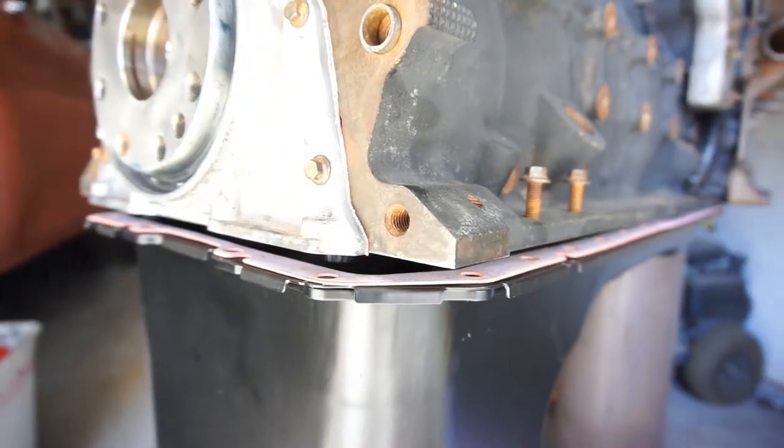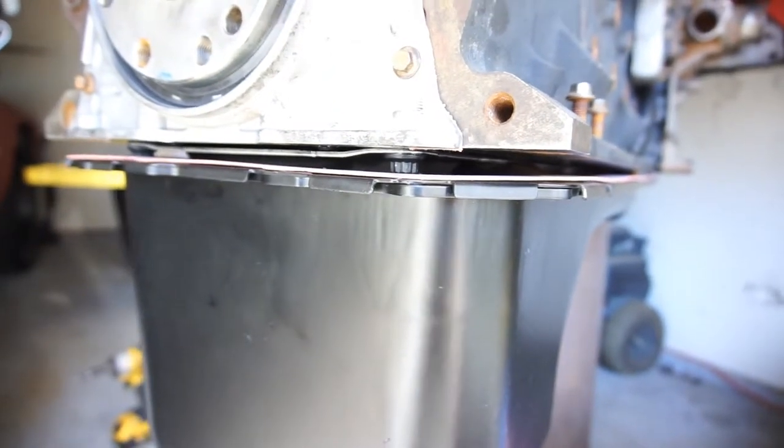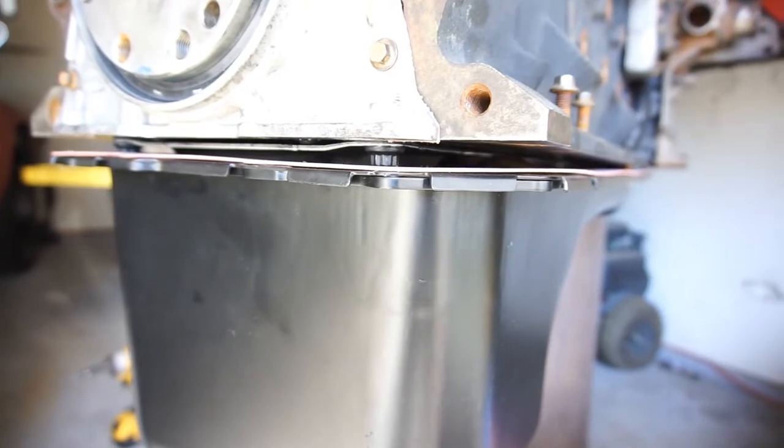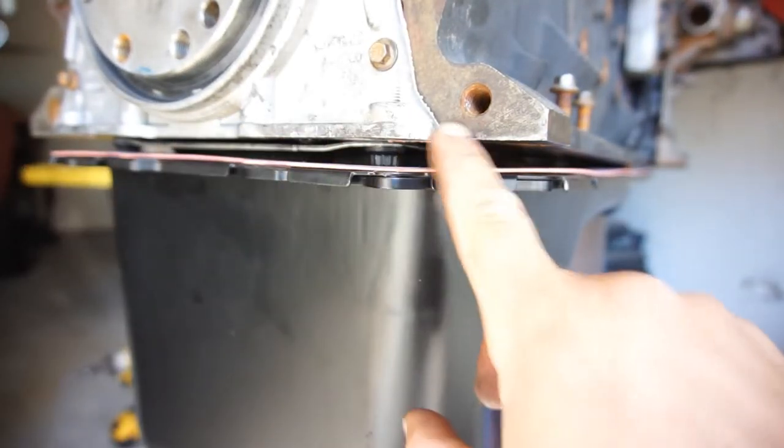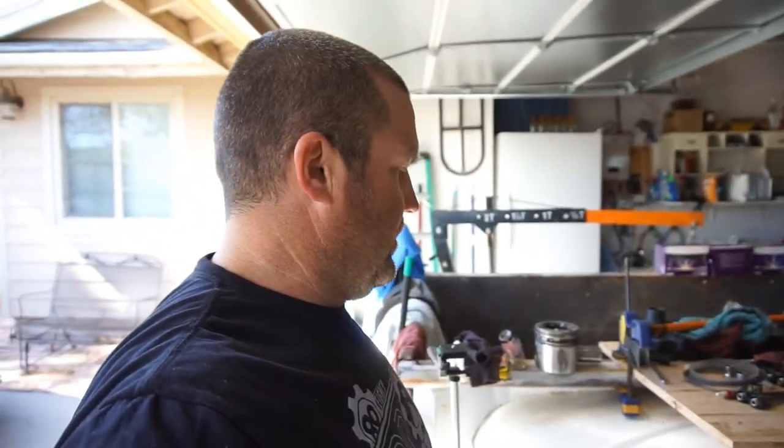You can see you've got a good ooze of sealant all the way around and a nice flush bottom. Once you put the oil pan on, just do a little dab of silicone in these corners, and in the front too. That's pretty much it — that's it for the rear main seal. Now I'm going to tape everything off, clean it up, take some parts off, and paint it all. Alright guys, thanks for watching — make sure you subscribe. Thanks for staying in for this long video.